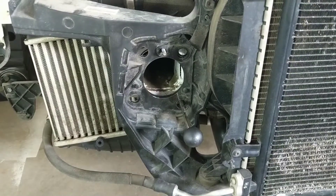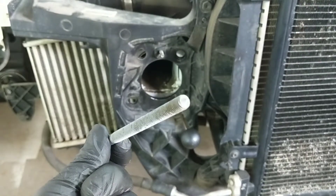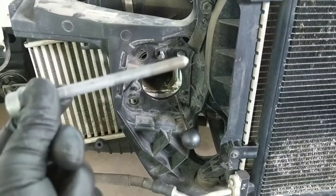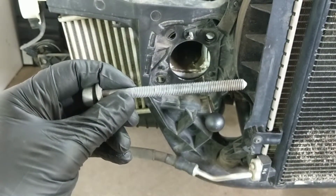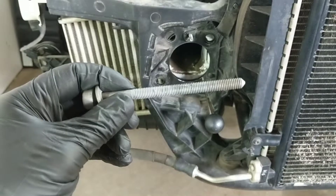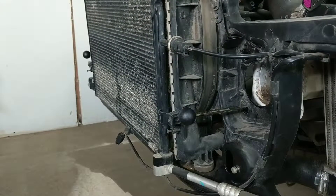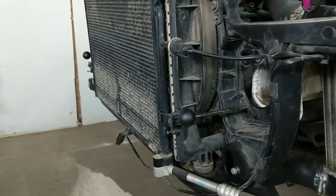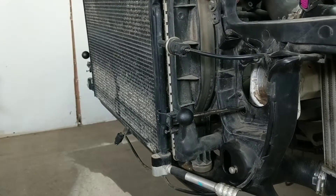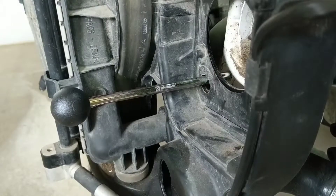There is a little secret to this tool and process, though. Remember those securing bolts that came out of the crash bar earlier? These are also M8 thread, meaning they can go into any of these four holes and actually double as this tool. Obviously it's not ideal that the lock carrier would get dragged across the threads on this bolt, but in a pinch it'll work, and it's free. Nonetheless, I think this is a must-have tool for Audi and Volkswagen owners. They're so affordable and useful — if literally anything broke on the lock carrier while it was out in service position without enough support, they're worth it. I would even buy multiple sets. Thanks for watching — please browse through my other tool review videos or subscribe. See you next time.